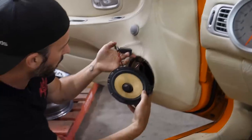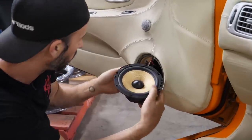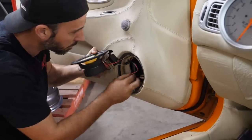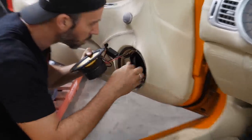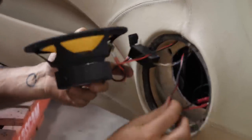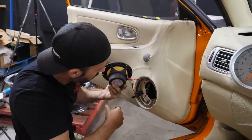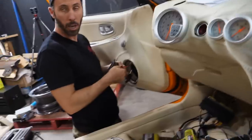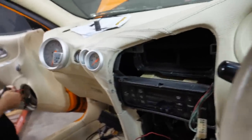There's a little crossover by the looks of things. And then does it go to speaker wire or factory looking wire? It goes down here. Quite a bit of wiring in there, actually. It just goes to these. What we probably can do is buzz that circuit out. Yeah, I can take these off. Yeah. Hold them together. Let's do that. And we buzz them. Yep.